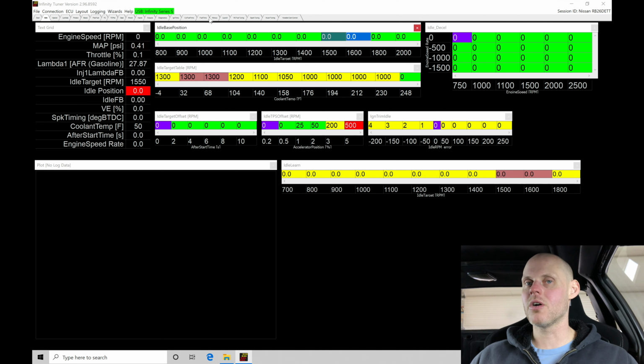So when we fire it off, the engine may run a little bit lower in RPM. We know when the engine is running, we're shooting for roughly 1,000 here. I don't know exactly where it's going to idle at. Might be 800, might be 850, and that's purely because the atomization is poor and we have lost some of the torque. Now, what we've done to counteract this, let's just cover that real quick.